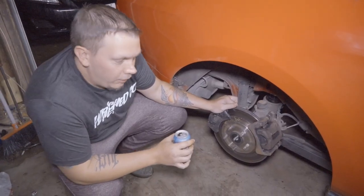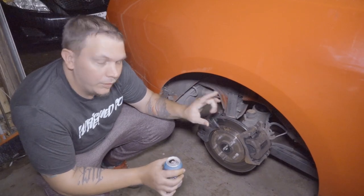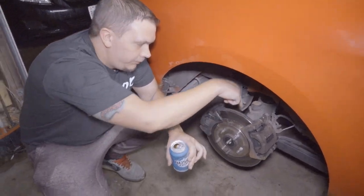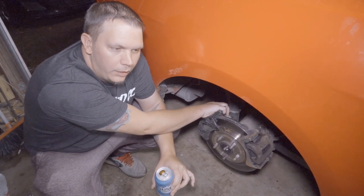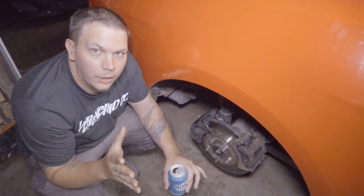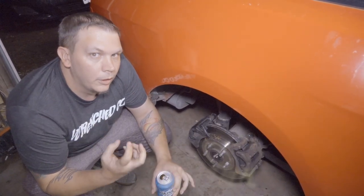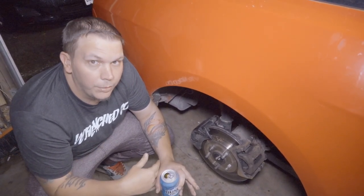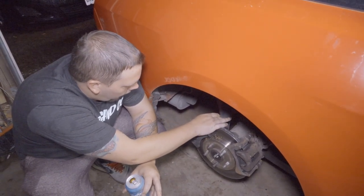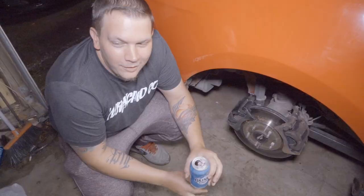For putting it all back on: you've got two 15mm bolts holding this side on. It's the same as the other side except the bolts on the stock side don't come with the kit — you only get the two for the new caliper side. Those bolts end up being really close to the rotor. You could probably get away without shortening them, but I wasn't comfortable with how close they were, so I went ahead and cut them down a couple of threads.